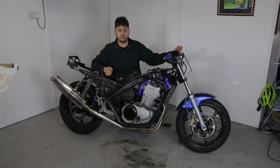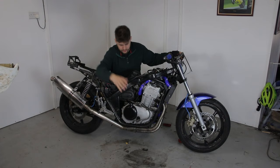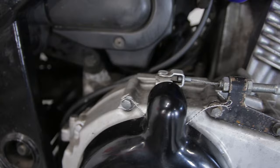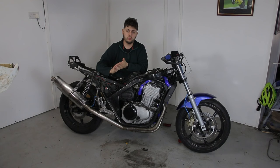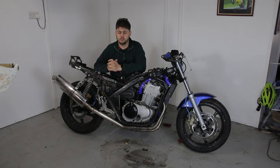When the ignition is on you can crank the bike, and when it's off it doesn't do anything — at least that's a nice tidy install. I've also got my rev counter on the dash now. I fitted a front number board bracket system I bought from Grant Whittaker — thanks very much, because I was going to make one but was fast running out of time. I've also done wire locking on the engine case sliders; you need that for the regulations if you're using the bonded type rather than the bolted type. I still have to cut the side stand bracket off and bypass the side stand switch.